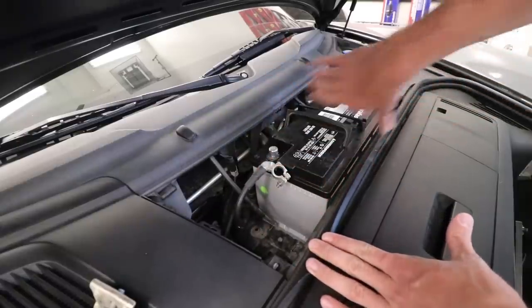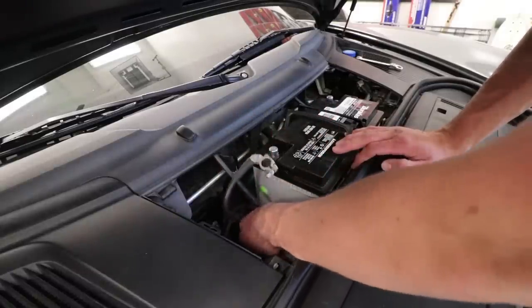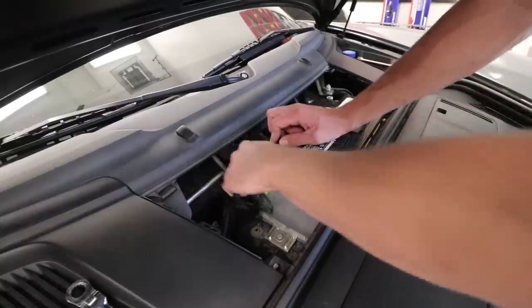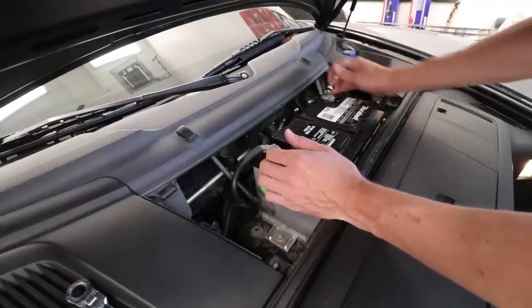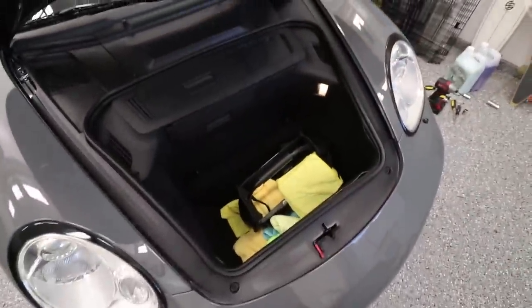The way these trays work, you put the battery in on one side and slide it toward the driver side. First I reinstall the battery tray holder piece, then connect the two terminals — negative side last. Right off the bat, you can see the light turned on, which is a good sign. Cranked those down and threw the cover back on. Before I shut the hood, I want to make sure the car can actually start so we don't have to pull the whole wheel off again.